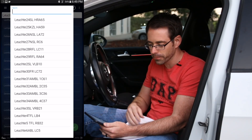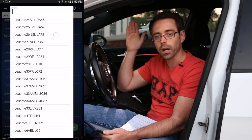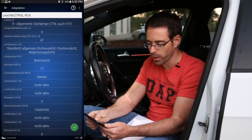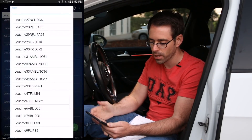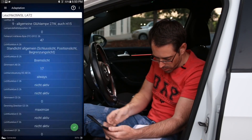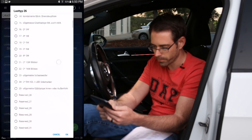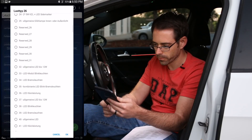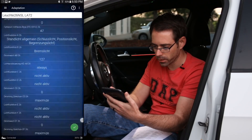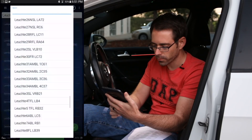This last section involves the rear fog light. On this car, because we have an older BCM, we're going to channel 26. On later model cars you're going to be going to channel 27. Basically, you're looking to see if you have information in there — if channel 26 is empty, the changes are not going to work there. We're changing channel 26 — the top value we're changing to 32. Then AB26 we're changing to 127 so our rear fog has full brightness. Hold that down.